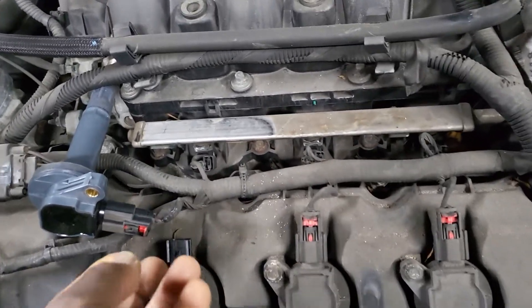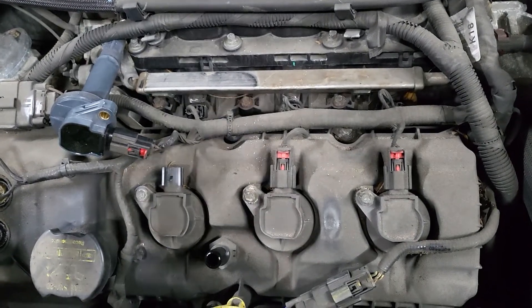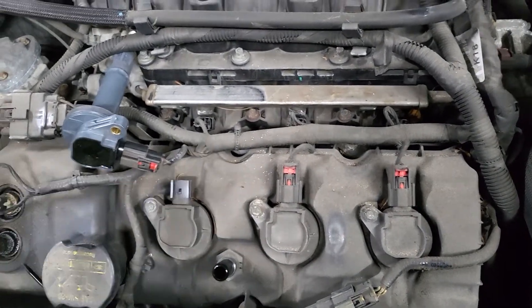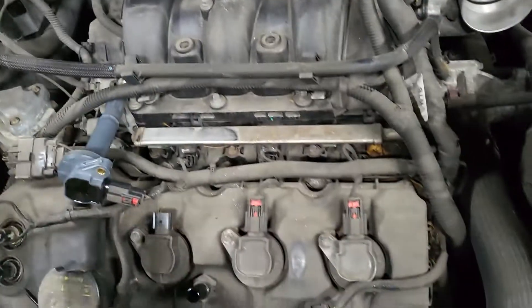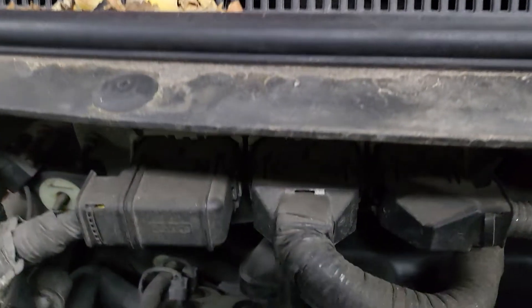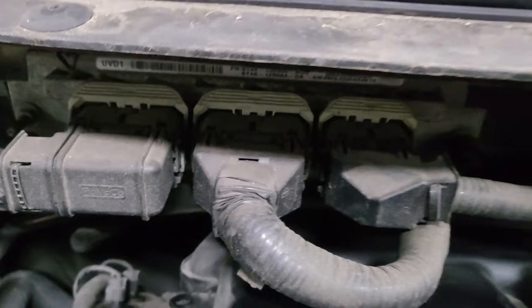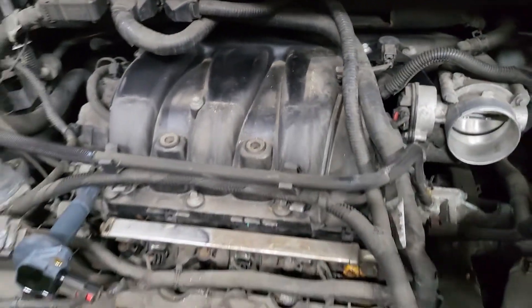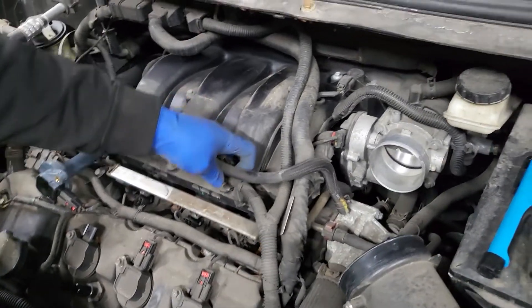Be careful with preventive maintenance. If you have any Ford and it's already 8 to 10+ years old, change those coils early. Because any short in a coil will blow out your engine computer. You're talking about $200–$300 to fix the coil versus $1,000–$1,500 to replace and reprogram the ECM. Put that in consideration.